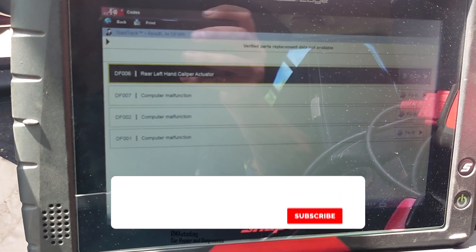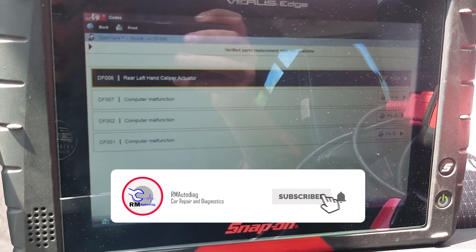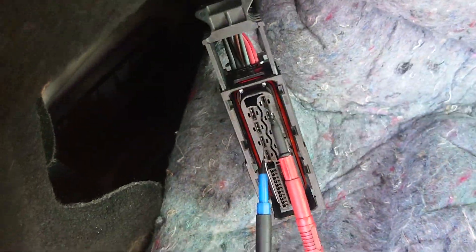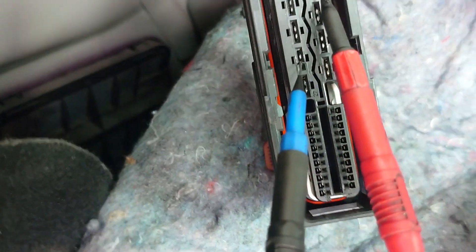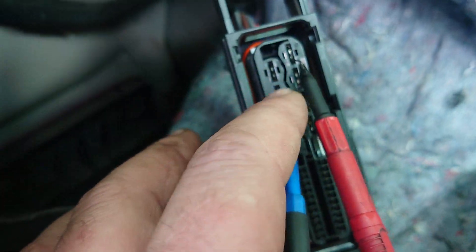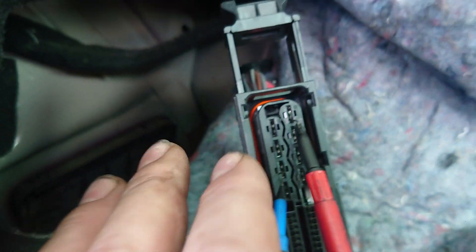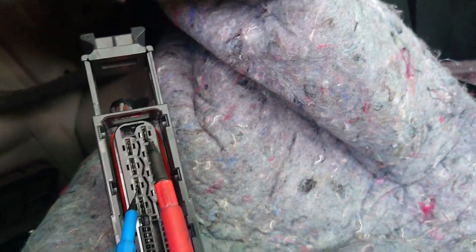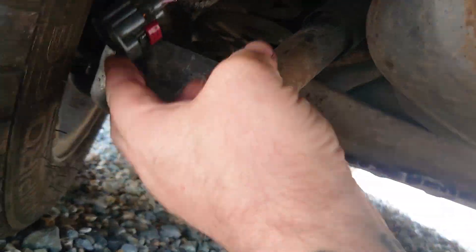When I came to this I thought it was just going to be a clutch switch issue, but it's not. What I've done is dug out the control unit. Pins 29 and 14 — you'll have to confirm them on your car if you're not sure — but that's the left-hand motor for me, which is down here.